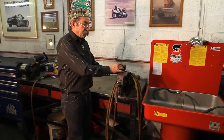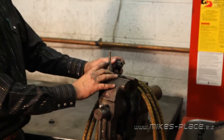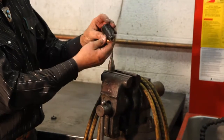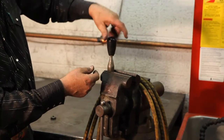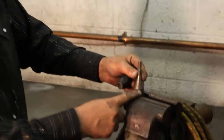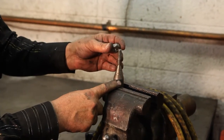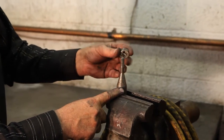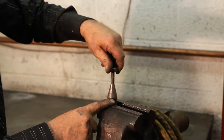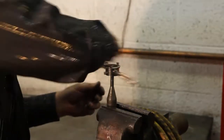Here's our shift lever — I've got it hooked up in the vise. Now to shorten this, we want to cut the threads down longer on the shaft. We can go down probably another three quarters of an inch. But once we do that, we can't really use the stock shift knob — the stock shift knob is actually set to go all the way down on the taper, so it will not go any lower. So when you do this job and create a short shifter, you're going to want to put a different knob on that actually threads and stops right here. The thread size on this is 10 by 1.25 — that's 10 millimeter diameter by 1.25 pitch. So you want to start this die on here and get it going; you don't want to cut it first. What you want to do is actually use the die first, then run the die all the way down until you cut your new threads.